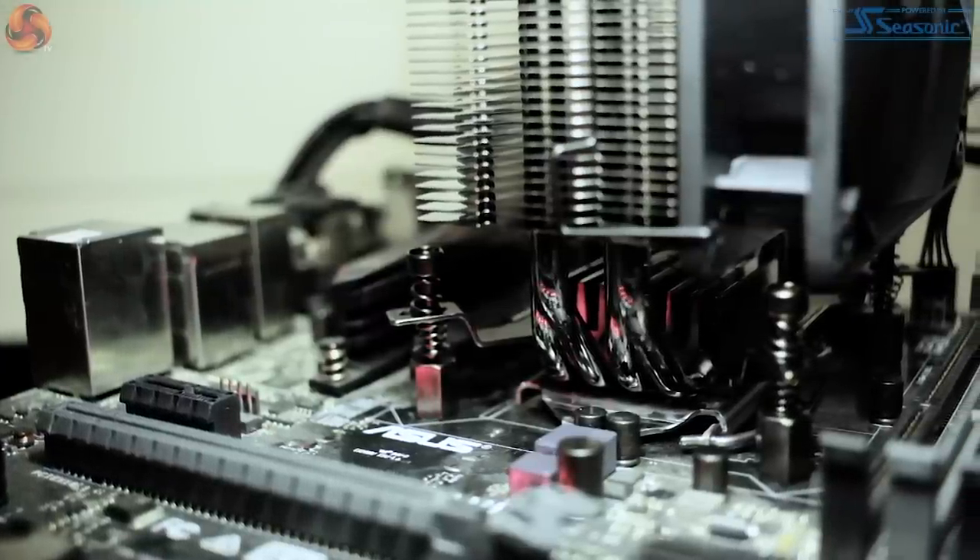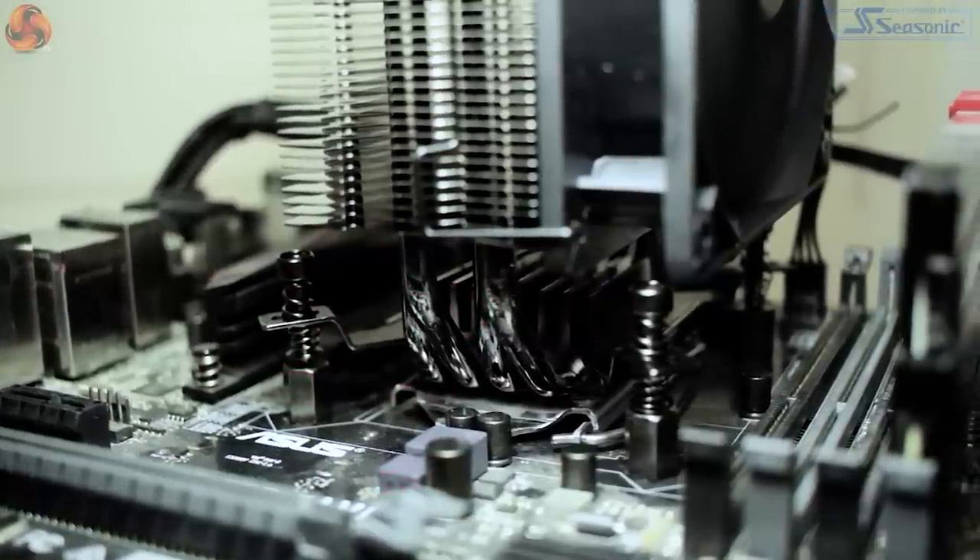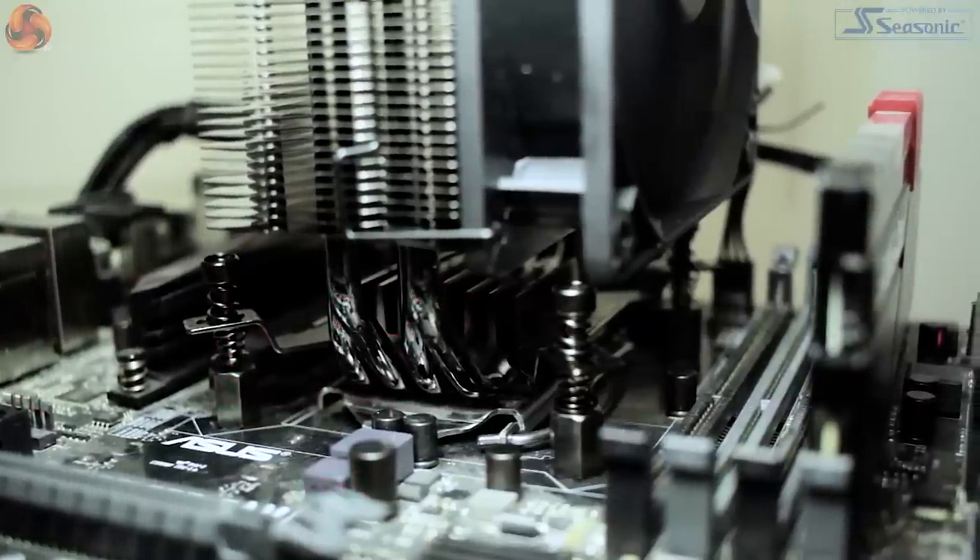With the cooler attached, simply replace the fan and connect the four-pin PWM cable to your motherboard's CPU fan header. Overall, pretty straightforward, although there are some minor adjustments that need to be made to the two separate mounting brackets. Instructions are nice and easy to follow, and it's also really cool to see that the mounting hardware has been given the same blacked-out treatment to keep everything looking uniform. All in all, a little bit less than 10 minutes to get the 212 installed, and this mounting process is a breath of fresh air compared to the Master Air MA410M cooler tested previously. The fans being held to the cooler with wire meant that the initial removal was tool-less rather than removing eight screws, and the more direct top mounting bracket was much easier to align. The fans being attached by wire also means that there's no awkward screwdrivering sideways with the cooler mounted.